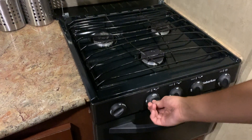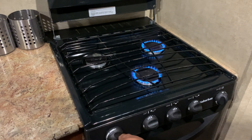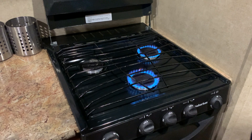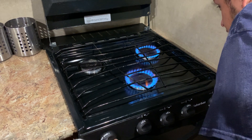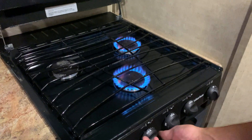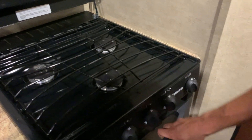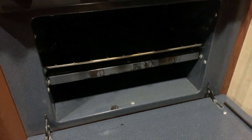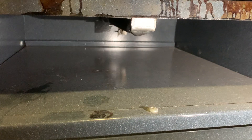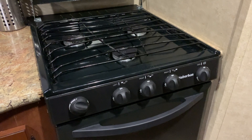The way you run that stove is you turn those knobs to light and hit the top burner ignite button — they should light up. For the oven, you're going to turn the knob to pilot. There's a little thermocoupler down there. You hold your lighter to it and after a few seconds of holding it, it should light up. Just keep in mind it does take a while sometimes to clear the air out of the line, so it can take a minute.